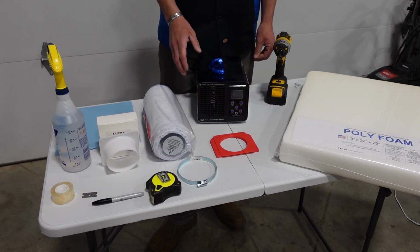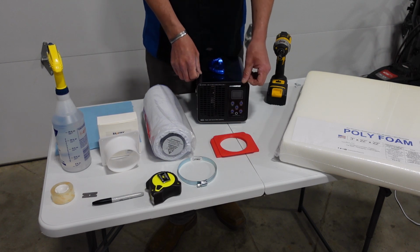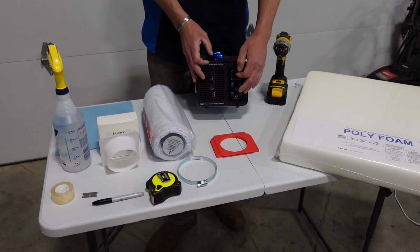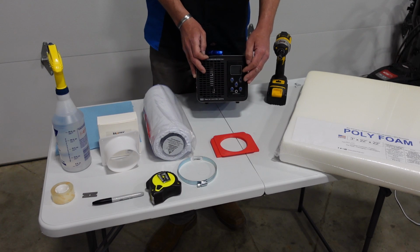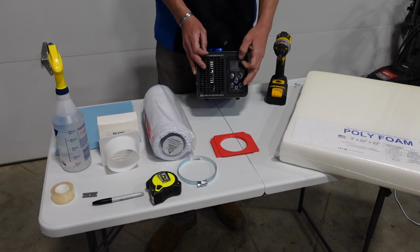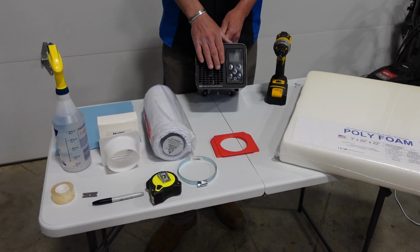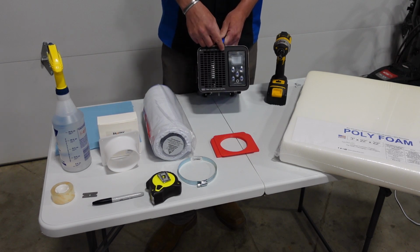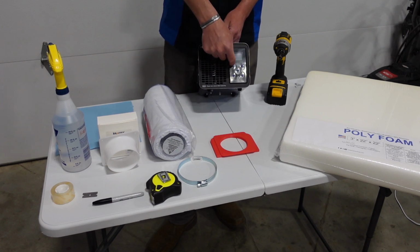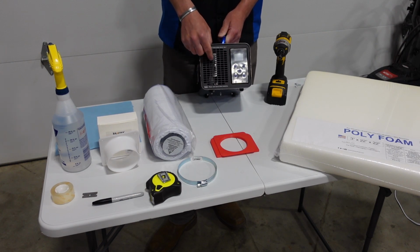And so the other thing was, a lot of the cheaper ones have mechanical dials on the front, and people would say that if they didn't set it to more than 10 minutes, it would just get stuck and it would run indefinitely. So I thought it was wise to invest in the digital control panel so you can set your timer and it's controlled digitally, so you don't have to worry about a mechanical position switch getting stuck. So far, that decision has worked out great. The only downside to this is you can't have it turned on and then plug it in so that you can activate it without being close to it. You actually have to get up to it, turn it on, set all your settings, and then when you quit touching it, you have 5 seconds before it'll start generating ozone.